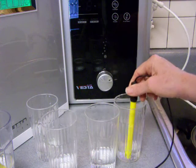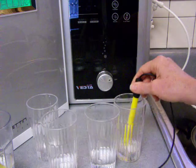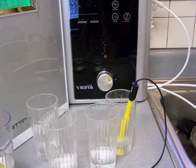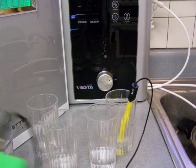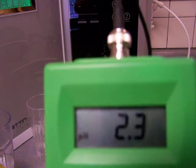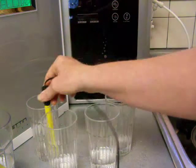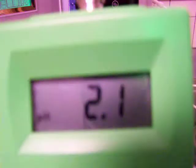It's going back and forth between the two acid waters. It looks like the Tyent's acid water is a little bit better, perhaps. Kind of surprising. Earlier today I was getting a 1.9 acid water for the Samsung, but this one is just showing like a 2.4 pH or 2.3, which is very good. Anything below 2.5 is going to kill germs on contact, and the Tyent's coming in at a 2.1.